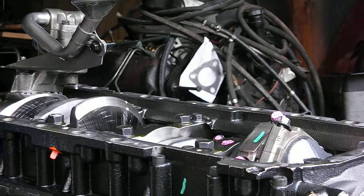Okay, Leroy Diesel, another video — we're doing the piston removal this time. A couple things I want to show you: this is a P400 and I'm taking the connecting rod bolts loose. On the bolts, they are actually bolts that come through this way into the connecting rod, instead of the head of the bolt being over here and the nut being on this side. This uses a bolt — and I'm trying to do this with one hand.